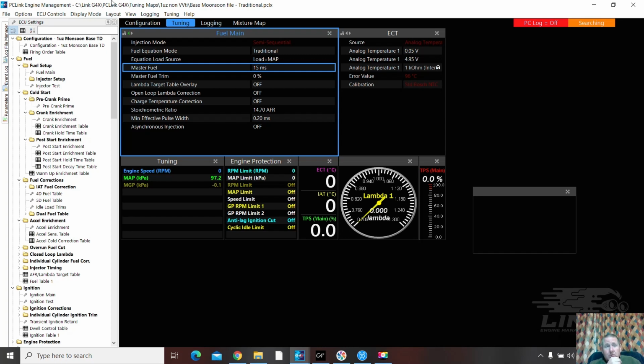I would normally allow at least half a day of setting up, building a profile, getting the engine running, getting the vehicle running, to idling, sitting and revving nicely, and then I double check all the inputs and the temp inputs and stuff like that. I've normally got a lot more stuff going in. I've got oil pressures and stuff like that, extra digital inputs. I pretty much fill up the pinout when I do these. And that's why my looms do cost a bit more money. And they are going to come with a map that's going to work.